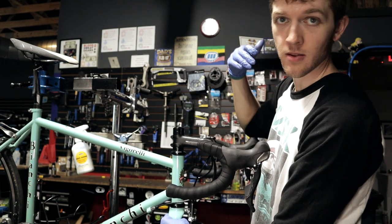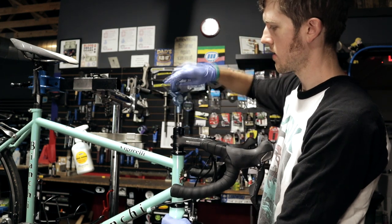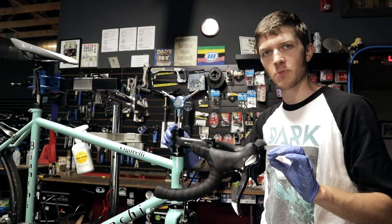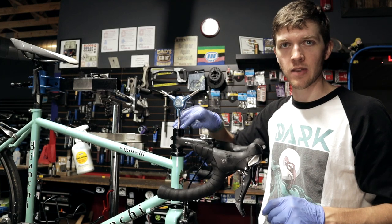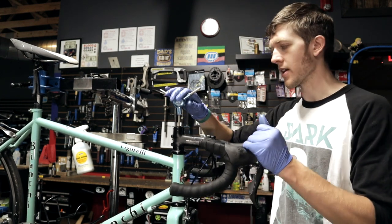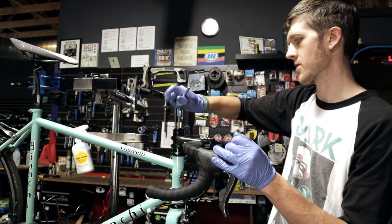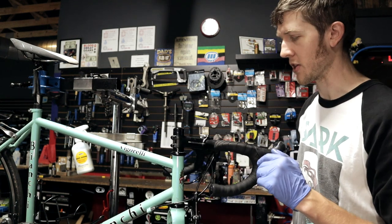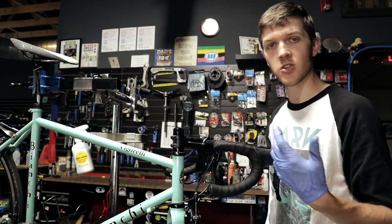Your fork is just free-floating in here so it will fall out if you let go. I usually get this started by hand and get it to where it's snug. A lot of times your pinch bolts will actually have a torque spec — these actually say 5 to 6 Newton meters. This top cap — they call it a compression cap for a reason — it is literally what keeps the fork from moving. Right now there's a lot of play; when you tighten this down it is going to take up that play. You can tighten it down too much, which I'll show you. If you tighten it down too much you're not going to have fun when you steer — it's going to feel very bad. It needs to be free-floating, and if you do tighten it too much you can either crush your bearings right now or just wear them out prematurely.